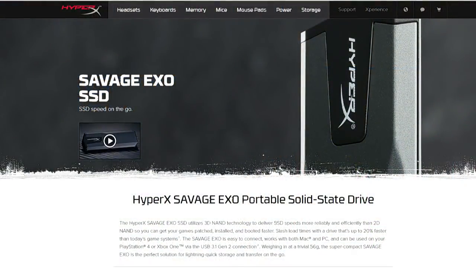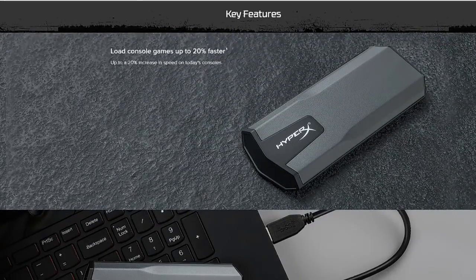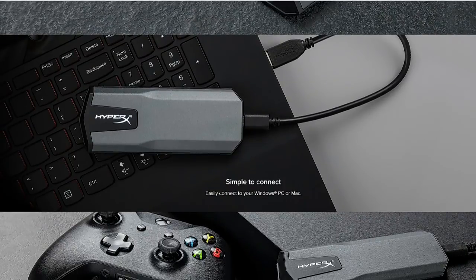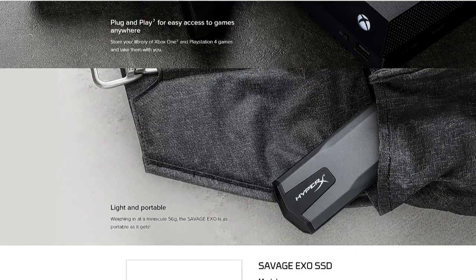Now, this gets a little bit confusing. I was flipping through this review. We haven't tested this particular HyperX product yet, but USB 3 usually gets confusing because you don't know if it's Gen 1, Gen 2, 5 gigabit, 10 gigabit. There are different variants, even for whether it's USB-C or not. Then you have all of these different ways of plugging either an M.2 SATA or M.2 PCI Express SSD internally inside one of these external housings, and then there's whatever chip they're using to convert from one to the other and make that translation.